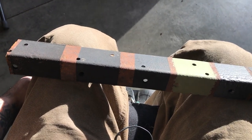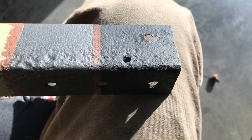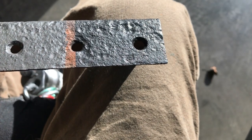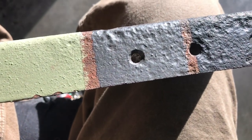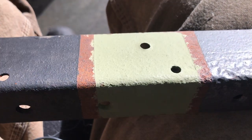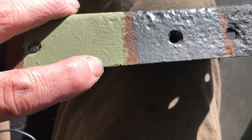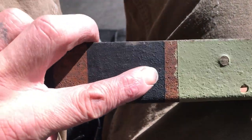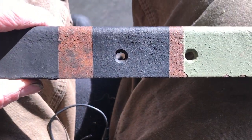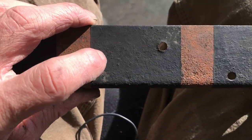Anyway, let's get on with the two-year review. Looking at it here in direct sunlight, this is the Ace Rust Stop and it really looks no different than it did last year. Same with the Rust Encapsulator — not very many differences, no new rust poking through. The internal frame coating looks like there are some chips that got nicked off the corners. The Eastwood Rust Encapsulator doesn't really look very different after two years. The Chassis Saver maybe looks a little more faded, but again no new rust poking through.